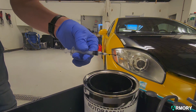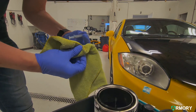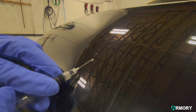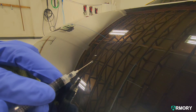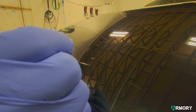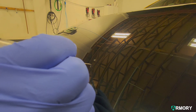We've got a cloth we're just going to use to take the excess off. Now we're ready to do a little bit of a touch-up. What I find works best is if this little opening is held to the side as you kind of gently push it out. You can see that we're kind of filling that entire chip. This paint is a little bit runnier than most. We're just working it into the edge of the chip. This is something that you can't do with a paint pen or brush because you won't be able to get it right into the edge.